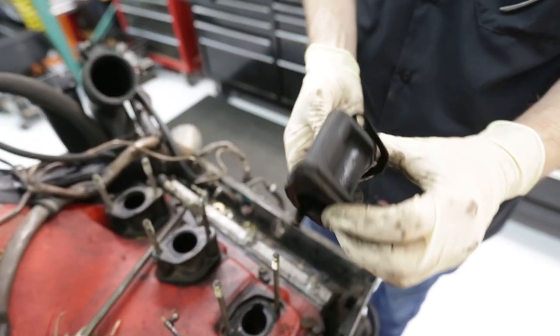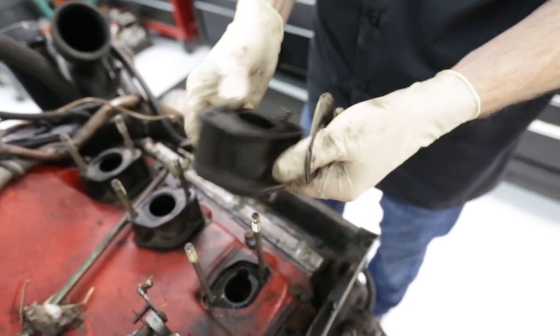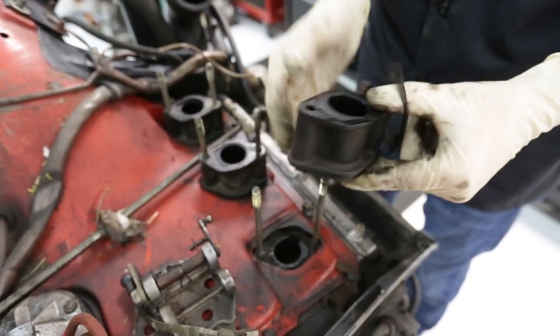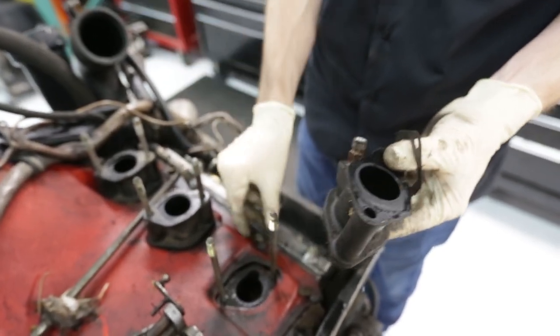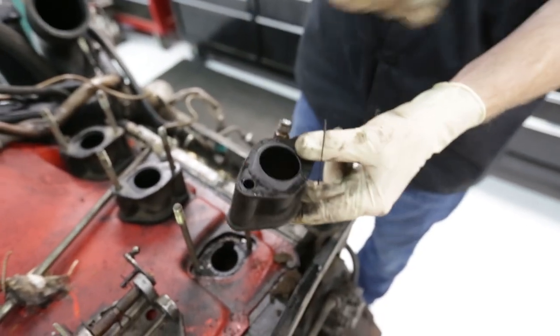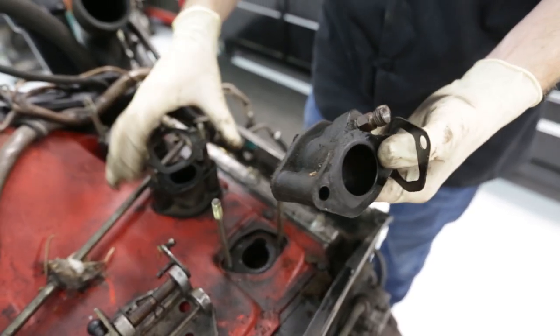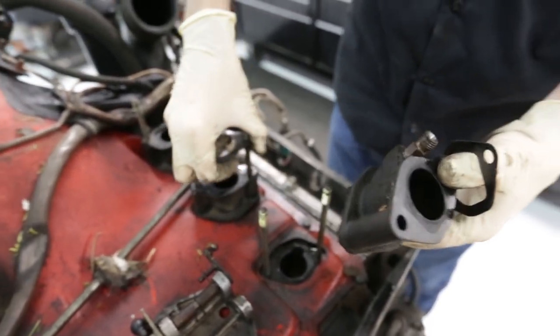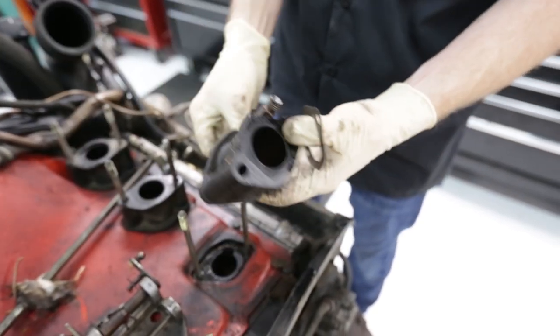Okay, so there's our fuel injector. Sprays down kind of behind the intake valve. But it's a little off tangent. It's kind of odd the way they do that. It might have been part of their strategy for swirl. Of course, it might have been just the only way that, you know, Gunter or whoever the engineer was figured it could fit. Regardless, doesn't matter.